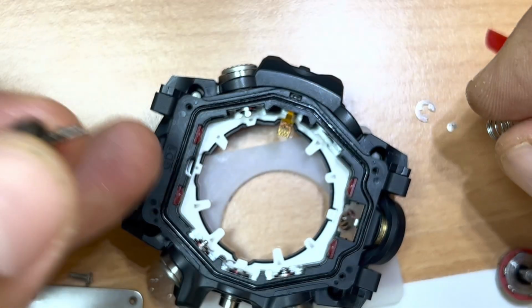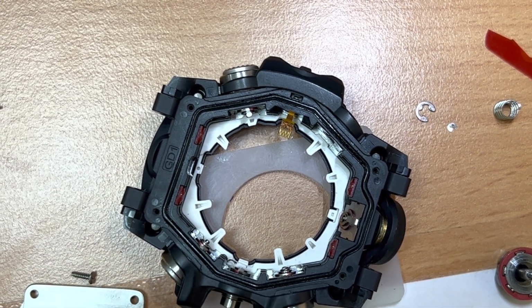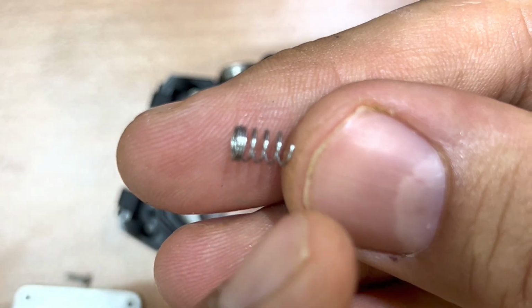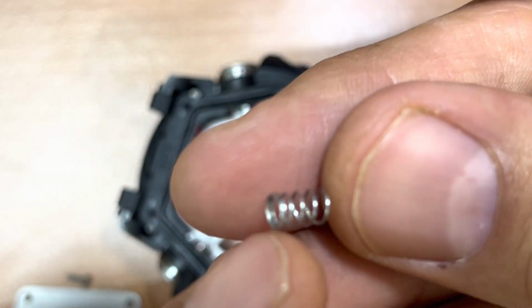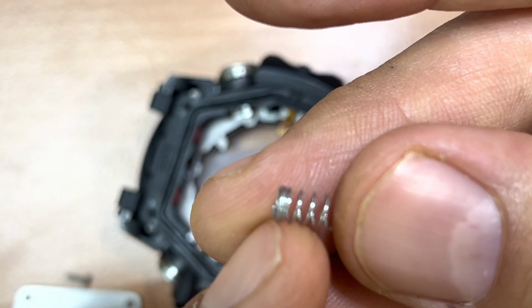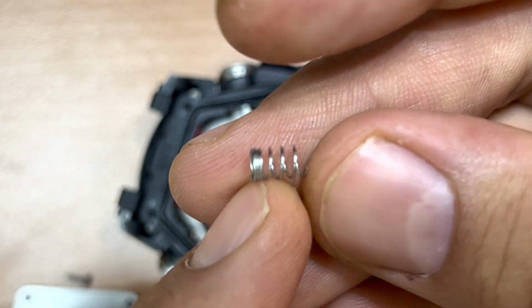They've kind of, not really sure why they didn't use a larger spring to start off with, like they've done with the light button. But these small springs seem to tend to wear out after a while, or to lose their springiness. So what I did, I got a pusher. I don't really have a pusher or a pushing pin or like a mechanical pin around me right now, but I just removed the little spring, and I tried 2 types of cuts. One from just the center part to where I have all equal distances between the springs, and I also tried out the end cut. And it turns out the end cut works better when it comes to its ability to spring back. So here you have, besides the little condensed 2-3 coils at the beginning, an additional 3 coils coming up, and that, based on my experiments, seemed to be the maximum number of coils that I can take before this thing would shoot out when you press it, as I was testing it out.